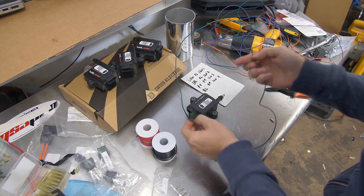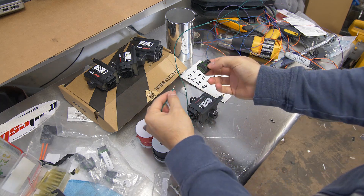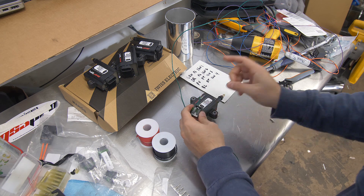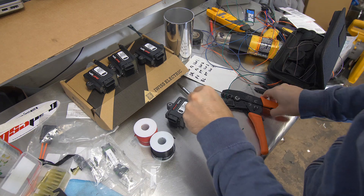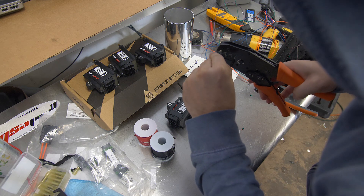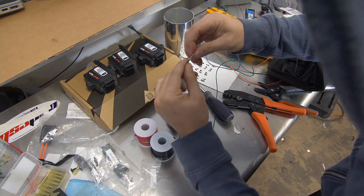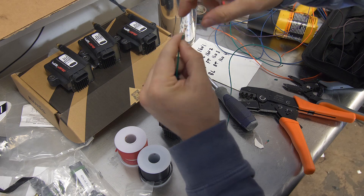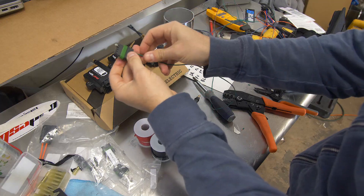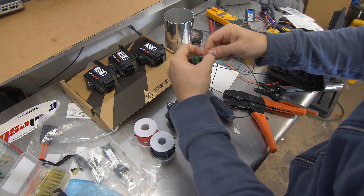Since this is going to be green I'm going to use it for ignition one, so that's going to be our trigger — that will be the first pin. The way that this waterproof connector works is you slide the wire through first, then crimp the connector on, and pull it back to seat it. You place the pin carefully in the crimper so that both claws will crimp down onto the wire — squeeze — and the claws have grabbed into the wire. It should be really strong. Then pull this down, make sure orientation is right, and pull back. You should feel it snap into place.